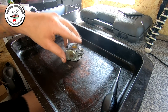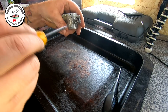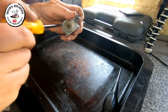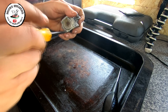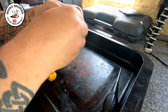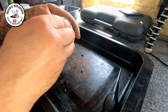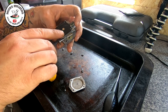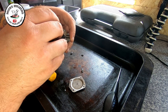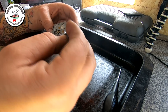Let's now attack this side — the diaphragm side. I want a little tight flat-headed driver to open this one up. That wasn't particularly tight but there's a little bit of rust in there. Now on these the diaphragm itself has a little keeper — it keeps to the back of the needle arm. Before I take this all off I'll double check it's actually on the needle itself. First of all I'm noticing there's no gasket on here — no gasket. And let's see if he's hooked it up to where it should be. He hasn't.